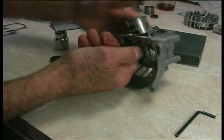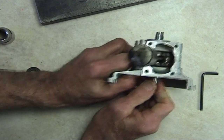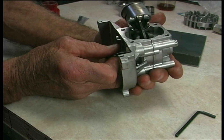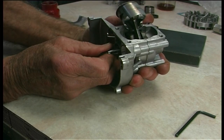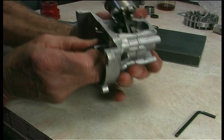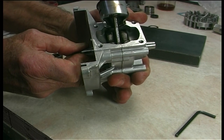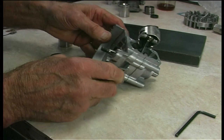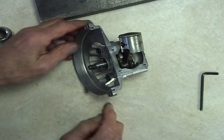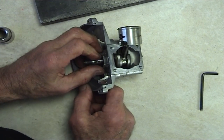I suspect it probably hasn't made a huge difference. If you look carefully you can actually see the crank moving back and forward there — that's too much. I had previously had this motor out to change the barrel; when I nipped it up I noticed it had excessive end play then.